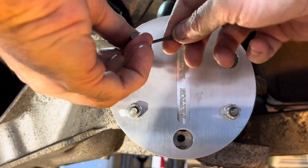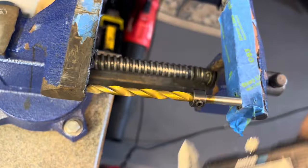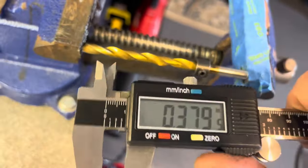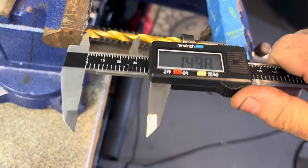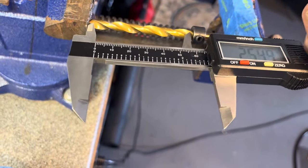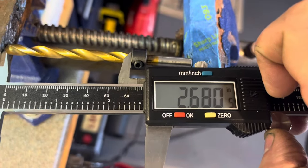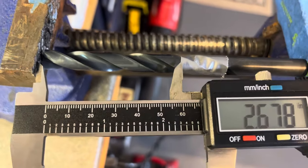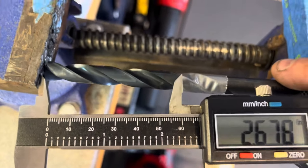To see how deep you need to drill, stick the D-for-drill guide in, using a quarter-inch drill bit, snug it up and screw it tight — that gives you a depth to the bottom of that tap thread. I measured 2.68 inches; transfer that to the drill bit with a piece of duct tape as a depth marker — electrical tape is too dark to see.